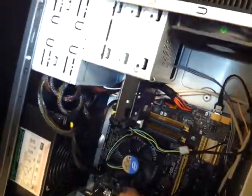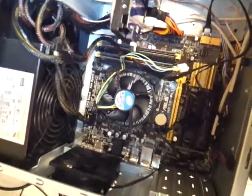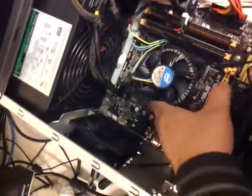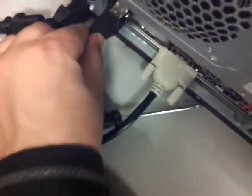I'll need both hands to push that fan back, so I paused the video. I have just finished installing the processor back — make sure it's sitting tight right on the processor socket. Let's check the display. Press the power button, plug in the keyboard, mouse, and DVI cable so we can check for any errors. When the processor is not sitting right you'll get a motherboard power warning. Let's turn it on and see what we get on the display.